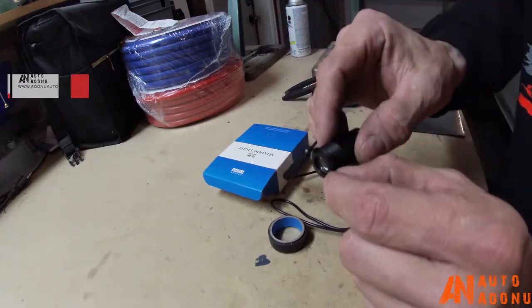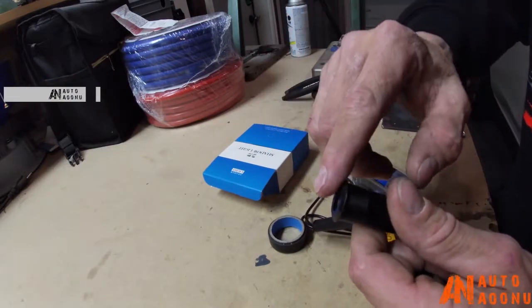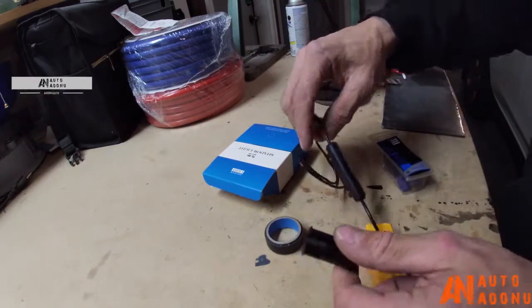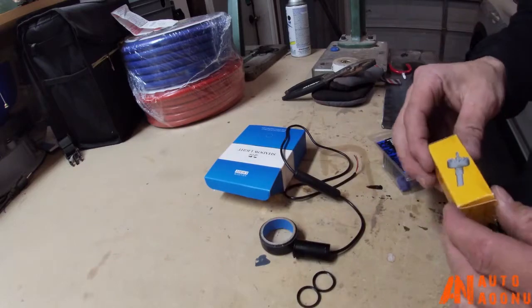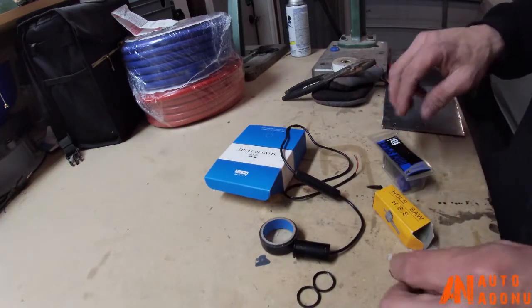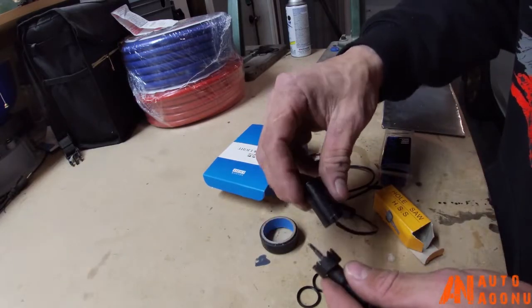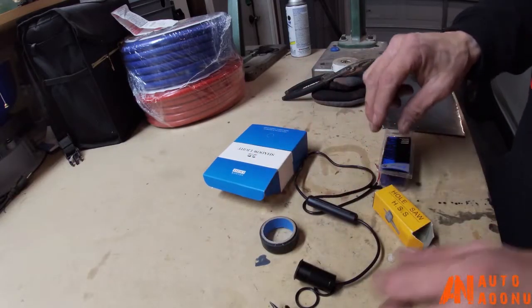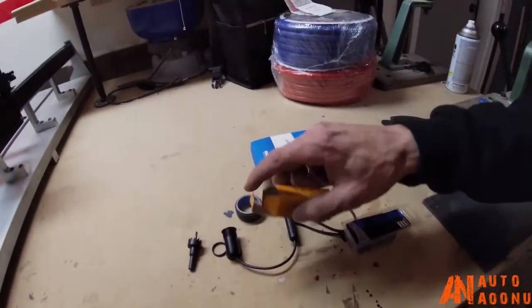that in there. So basically this little 1/8 inch thing will stick out underneath your door, which you got plenty of room under there. Just make sure on your vehicle that you put it in a spot where it's not going to hit your bottom door sill. Gives you the hole saw, which is perfect size. Drill that out, stick it through your door, and then hardwire it right into whatever you got.